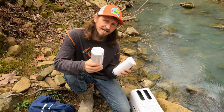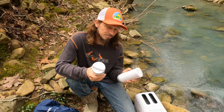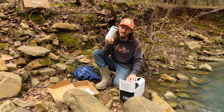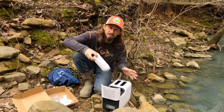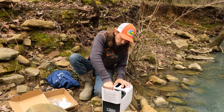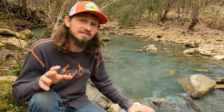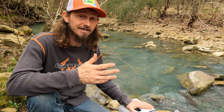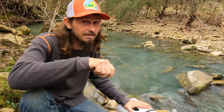Something else I'm liking about this product is that every piece so far has been labeled and it's very easily disassembled. Right here on top it says hybrid — we've got the hybrid filter. Push it in, quarter turn, and it clicks right in. I also want to point out: if this is your first time trying this piece of equipment, you may not think that the filters are locked in or tight enough, but they are. Just like the instructions say, put them in, quarter turn, they're in place. The key to making sure the filters are locked in properly is that you will visibly see the filter go down and depress, then you turn it just a hair clockwise and it locks right into place.